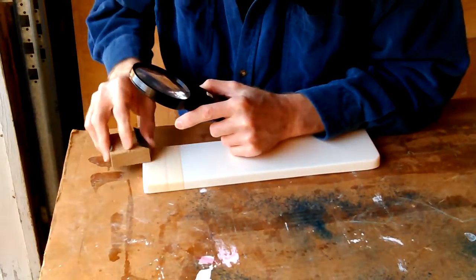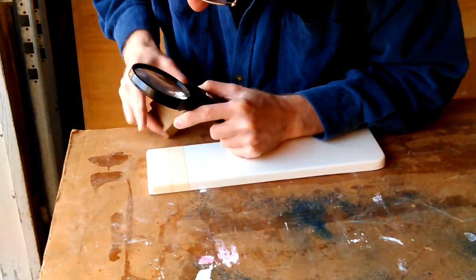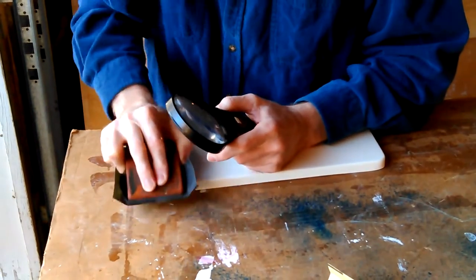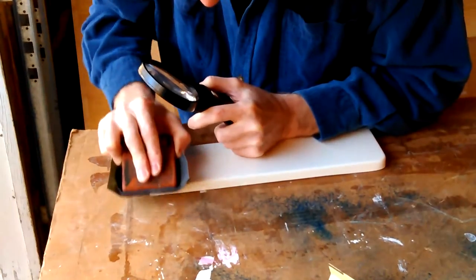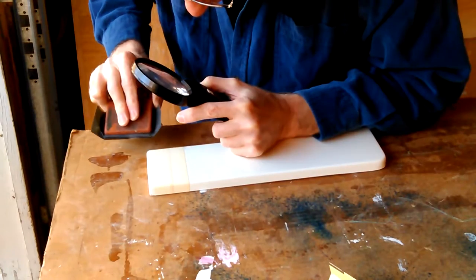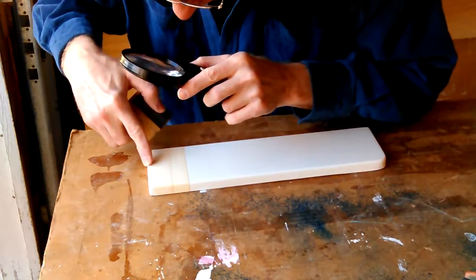What I'm doing is putting my corner around just off the edge of the tape, then lifting it up a little to try and blend without going through on my rounded edge. I'd rather have a little groove there than go through it. I want to hit it across once just to see what it looks like. It's not doing too bad at all. But it already hit the bottom on the back side towards me. I'm stopping there and I will hit that with scotch brite.